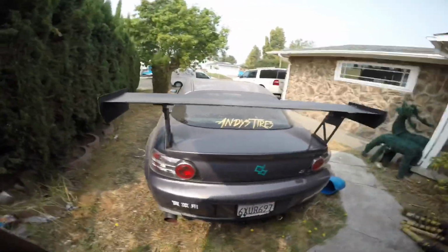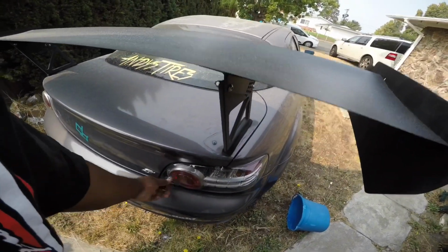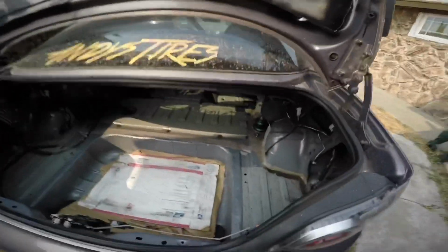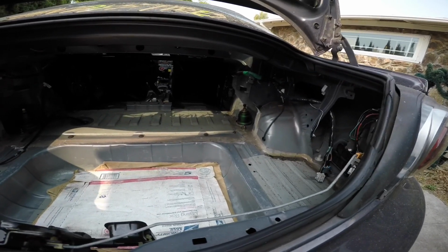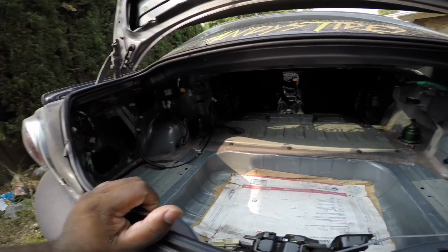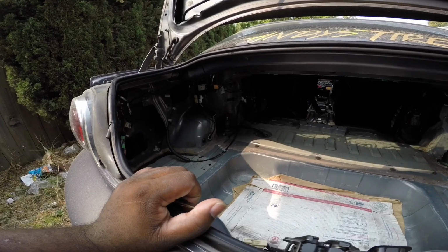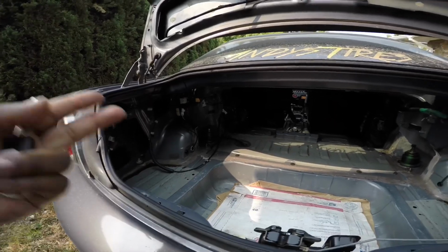Got a nice wing set on the back. It was set on the least restrictive setting. We could definitely change that to something else a little bit later on if we find that we need a little bit more drag, a little bit more aero properties. But it's just 100% stripped down, full-on coilover suspension. You can see those sitting there in the corners. I was gonna go ahead and buy those for the white RX8, but these have it on here. Given how rigid this chassis is, I was thinking about changing the springs because I think they're 16 and 14 K. Maybe want to do a little lighter for my preference, but I'm not going to change anything until we hit the track. Once we actually hit the track and see how this car performs, I may not change a thing.